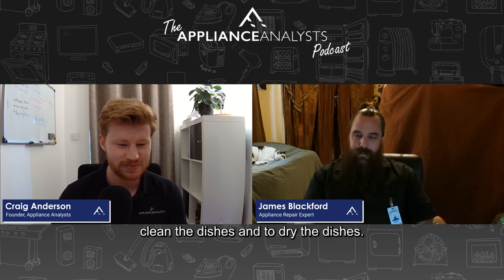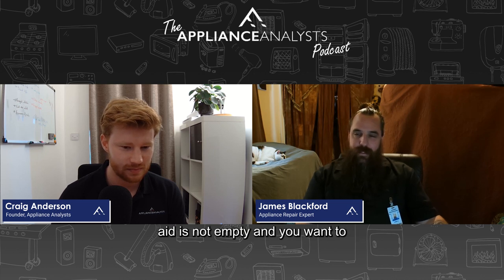So you definitely want to start out with the good habits of a dishwasher. I think we had talked a little bit earlier about putting some vinegar in a cup and letting that run through, because that does help to clean the dishes and to dry the dishes. You want to make sure that your rinse aid is not empty, and that it's turned up to max.